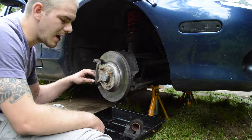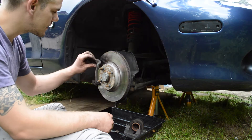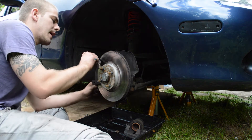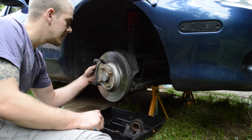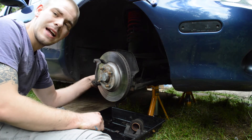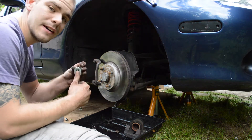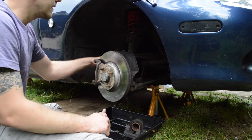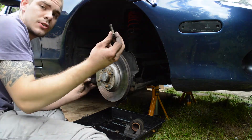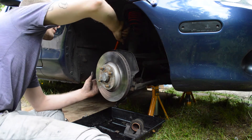The backs are low, so I like to do all the brakes at once with my cars. That way I can carry on knowing everything's done nicely and I know what pads I've got, so if I need to replace the rear I can get the same pads. I'm going to get the 14mm on here and take these carrier bolts off - there's one carrier bolt, two carrier bolts, and there's your carrier. So you've got your carrier and your caliper.